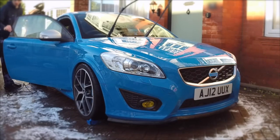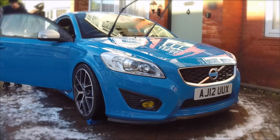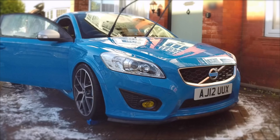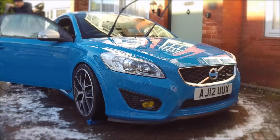Once the exterior bodywork had been sufficiently rinsed down, the shuts were also sprayed off at reduced pressure, as these are the kinds of concealed areas corrosion can quickly set in. On a relatively clean car like this, I'll usually just dry them off with a damp microfiber towel, but following the swim in the sea, a pressure wash was definitely in order.